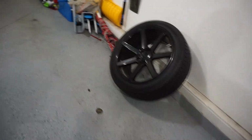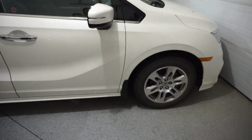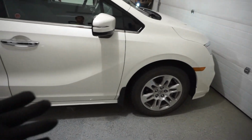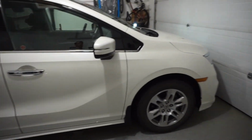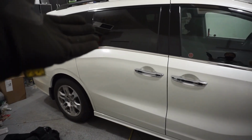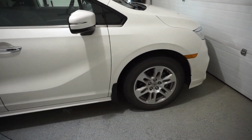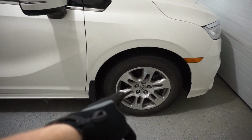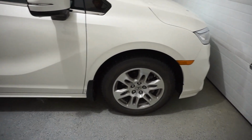A lot of you are probably looking at this video because you thought you'd pay somebody to do it, but hey, I could save the money and do it myself. It's very simple. You can do it literally with your emergency car jack, and it won't be as fast, but you can get the job done. All I recommend, obviously, is just having a torque wrench so that you can get the nuts on properly, and that's it. If you have your winter tires and you have OEM rims already, you can literally use the same lug nuts to get this job done. It'll cost you nothing more.